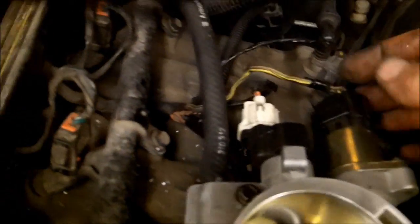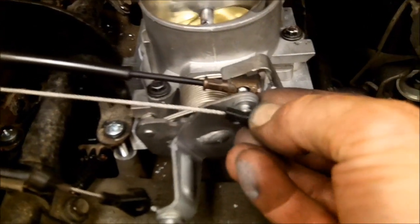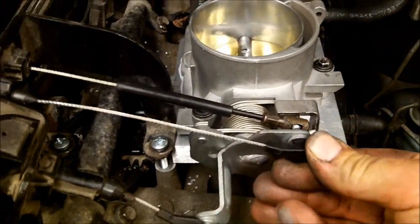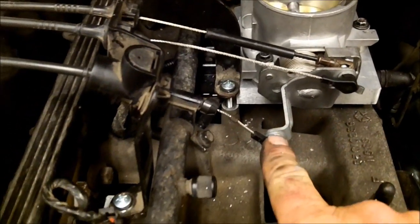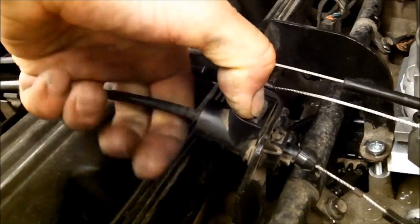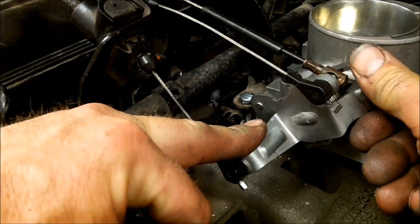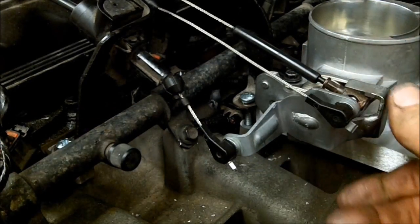Go ahead and hook up your electrical connections again — you cannot get them mixed up. Now get your throttle cables hooked up. Here is the cruise control — it's very easy, just like that. And then the TV cable, or kickdown cable — this one you're going to have to readjust. Pretty easy thing to do. Push that button in, pull this back — see how that cable slid in. All you've got to do is have that back, then run the throttle to a full throttle position, and you're going to see that ratchet back out. Right there. Now it is set.